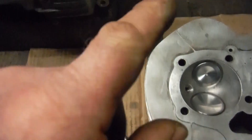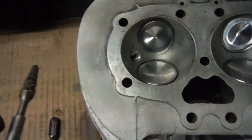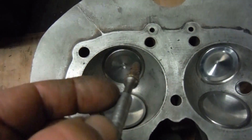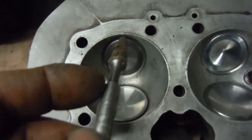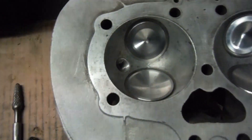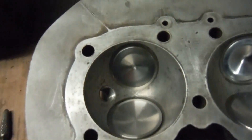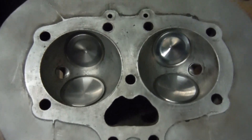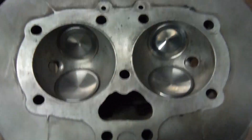However, that left me with a sort of concave entrance into the valve guide and I didn't really want that. So I very carefully used this pointed one, worked around the end of the valve guide around the outside circumference, to remove any sharp edges and hopefully just reduce the height of the concave edge at the end of the valve guide. Then finally I finished off with this stone — I carefully put it in there, spun it with the drill, and managed to flush the ends of the guides off nicely so they looked just like they did when they arrived.